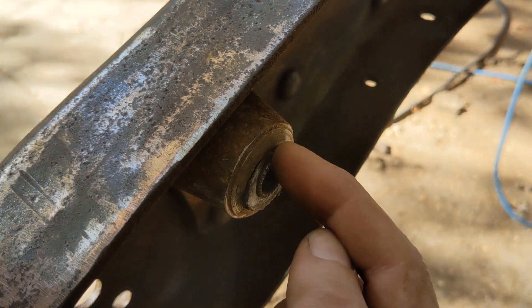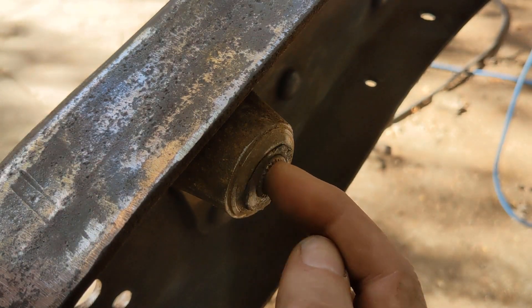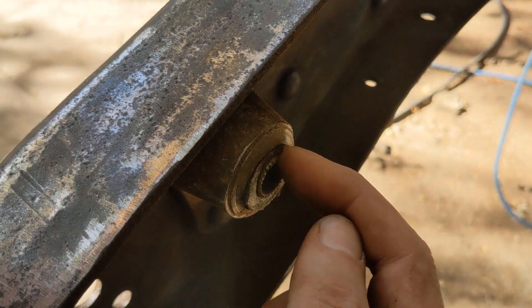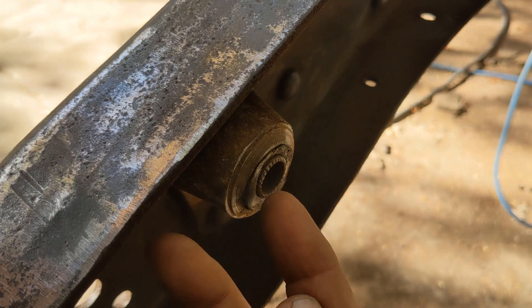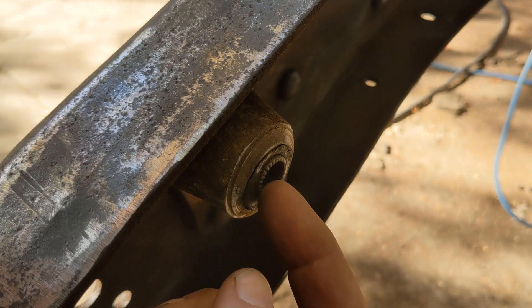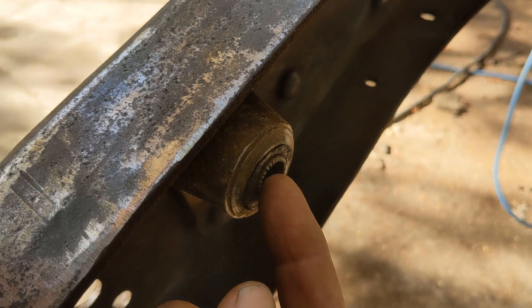You can't just smack on this and push it all the way through. You probably can on this centerpiece, but the problem is it's mounted in rubber and every time you hit it, it's just going to want to bounce back and absorb all of that. So we've got to get that driven out from the inside. One way I've seen it done — and I've done it on control arms before — is you just heat it up with a torch and melt all that rubber out. It's a really smelly, smoky mess, so I'm going to try to avoid it on this one.